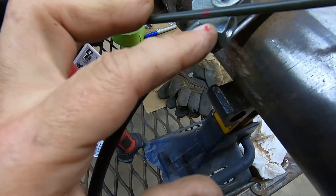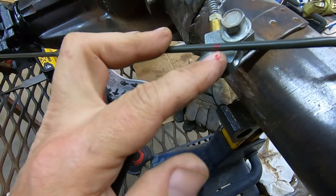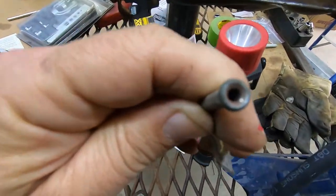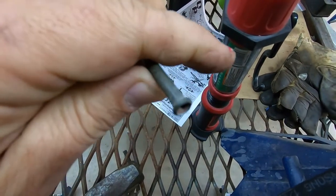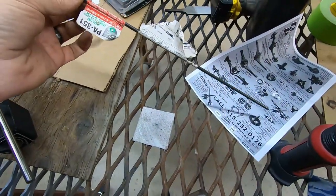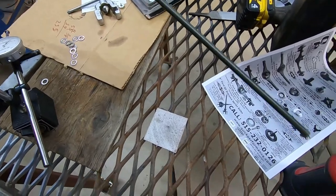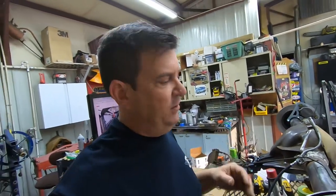And the termination point here, we know it's going to seat inside of this fitting, but I need to give myself just a little extra for my double flare. On a brake line, we want this flare that is folded over onto the inside. That gives you strength, it won't crack at the end, so your brake lines work out. And I mean, you can go like this, came from the parts store a long time ago. And you can buy brake lines in various lengths, but well, you guys know, you can't get exactly the length that you want, so you're gonna have to do some flaring.